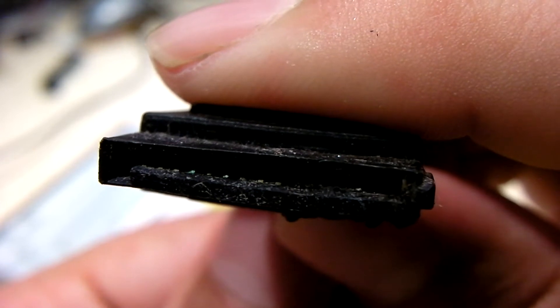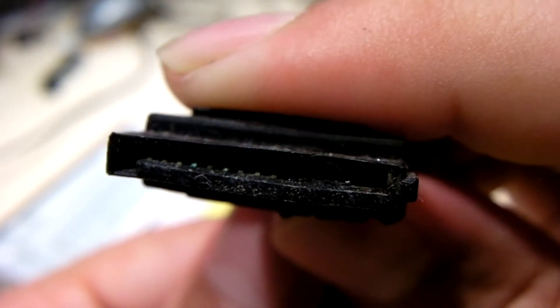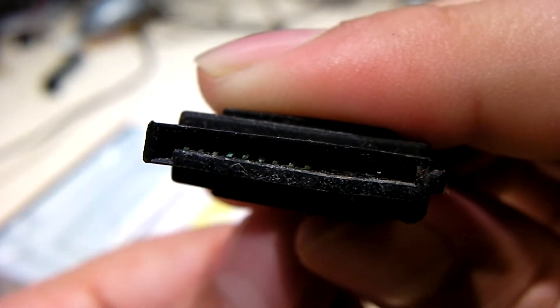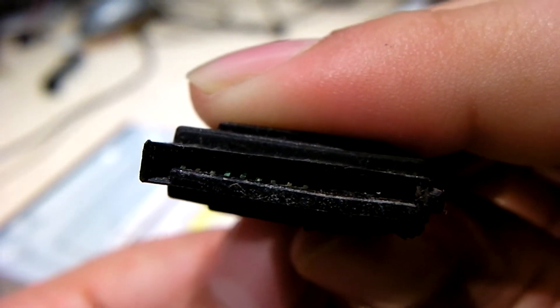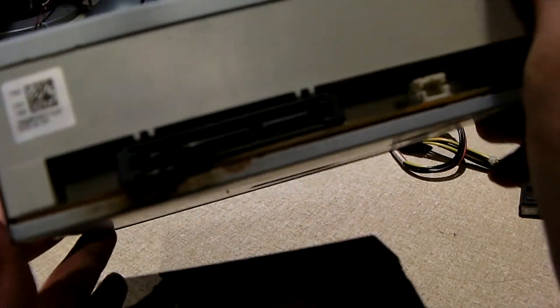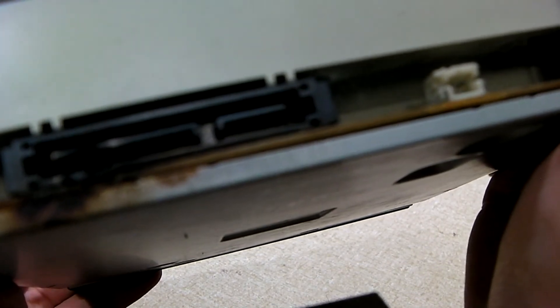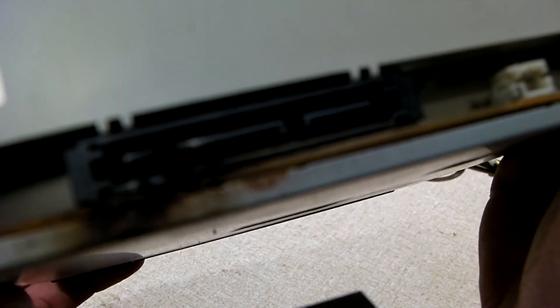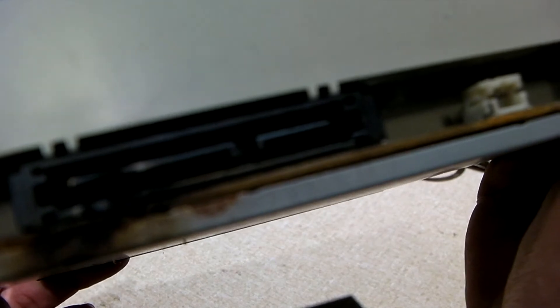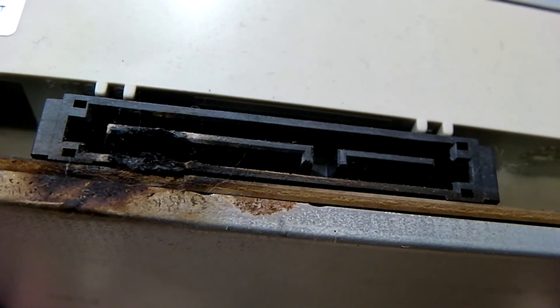You can see inside there how corroded things are. Maybe the cable or connector started to corrode a little bit before this actually happened, but again, you'd think in a regular PC power supply your short-circuit protection would kick in and prevent a fire from happening. With the HP 6000 Pro, I think what happened was it shorted out, but there was enough resistance in the wires and the motherboard traces. Since the 12 volts got passed through without going through any major conversion, there was enough resistance in the cables leading to the drive and in the motherboard traces that the main power supply did not notice a problem.